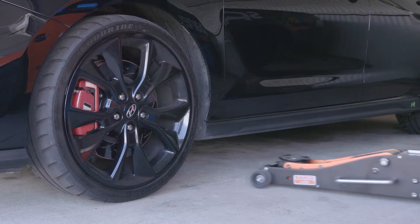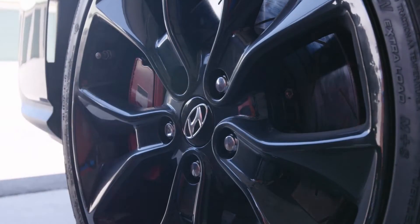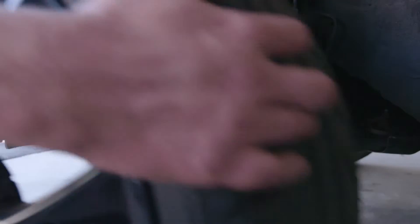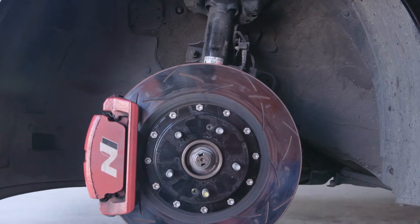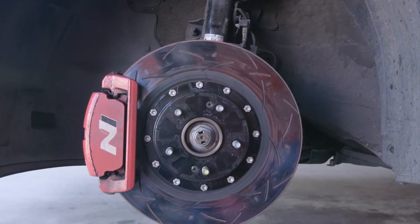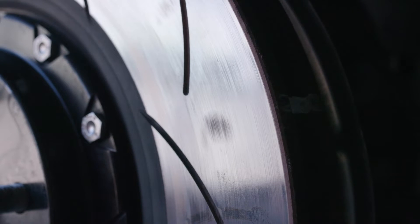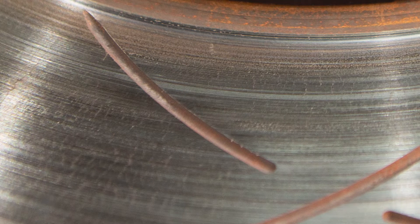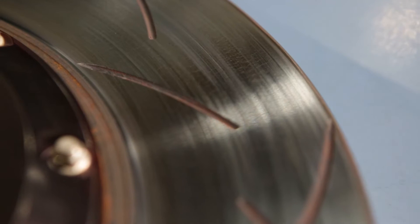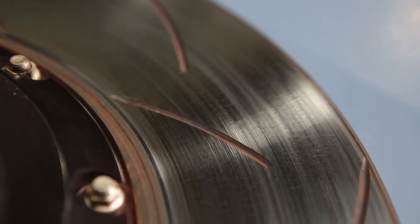All disc rotors and braking system components should be inspected after a track day. This involves removing the wheel and inspecting the brake rotor for surface cracking from fatigue on the pad surfaces. If a suspected crack is found, rub the area with a light-grade emery paper — 240 grit or higher — to confirm that it is definitely a crack and not leaching or etching from the pad material. Pad etching looks very similar to light cracking but will disappear with a light rub of emery paper. If the heat checking and surface crazing is advanced to the point where the surface cracks are clearly visible, discard the pair of rotors.